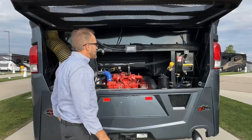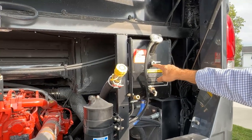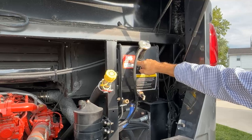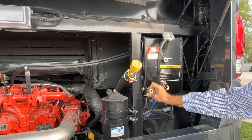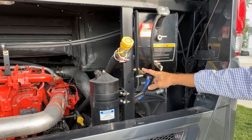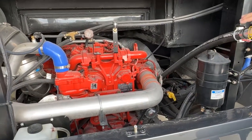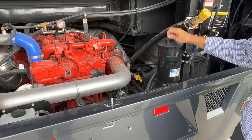On the right side over here, you'll notice there's a glass eye for the engine coolant. The engine coolant should be full up to this level here — it's just a tiny bit on the low end, but that can be capped off by opening this and adding some fluid called final charge. Just on the bottom of that, this is your auxiliary air line. You can use the hose that Newmar supplied to connect here to fill a tire with air or any other inflatable. We can check our oil and add oil here if necessary — the dipstick is here. This is our hydraulic level — we can check by pulling the dipstick out here.